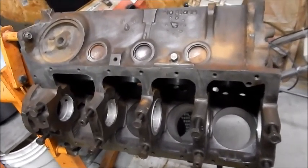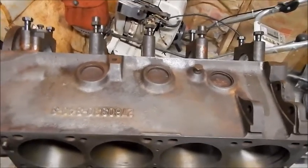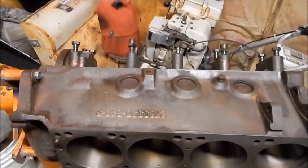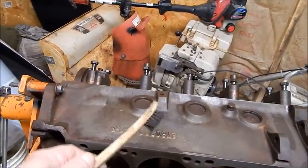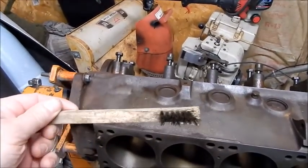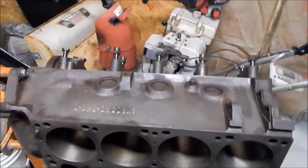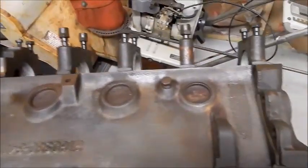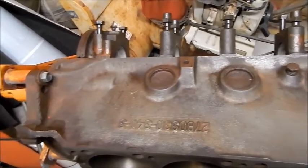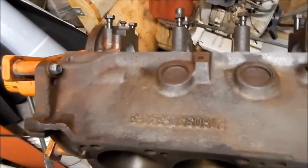This is the driver's side. I used a chemical rust dissolver yesterday on this side — I had the block sitting on the stand with that side up, sprayed the rust dissolver on with a spray bottle, and worked it in with a wooden-handled toothbrush. The bristles are plastic, but you could use metal. I let it sit for an hour, rinsed with water, wiped it with rags. You can see how much better that works than just using a wire wheel.